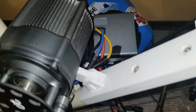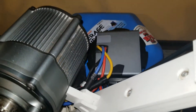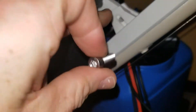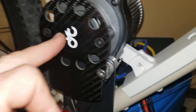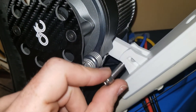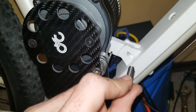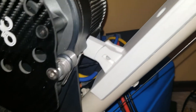The controller is wired in — it's just the 3-phase wires and the hall sensors that you can see down there. I've set it to one side and I need to get this part in now. What I'm using here is the bracing piece that's going to hold the motor in place just in case any torque forces it forward when it's spinning. I'm going to use an M5 or M6 bolt — it's a fairly tight fit but that should hold it in place. I'll just use the one bolt and get that in there.